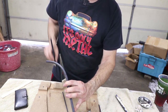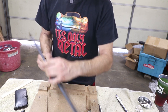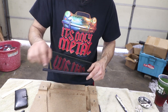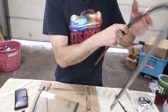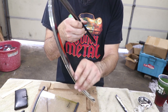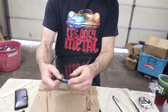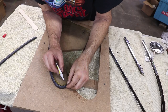The kit does come with a short section for this piece here, so we've got enough material. The other issue with the rubber is that rubber always shrinks over time - so while we want to stretch it right here, we actually want to compress it right here so we don't develop a gap in the corner, like the window I took apart had a big gap because eventually with heat and sun the rubber will just shrink. I've prepped the frame with a little bit of 400 grit because there's a little bit of chrome flashing and old remnants inside that channel. I also might put a tiny little dab of super glue here on this corner because I've stretched it and I don't want it to relax anytime soon.